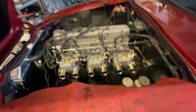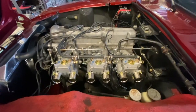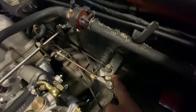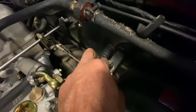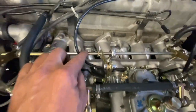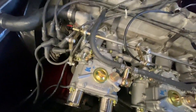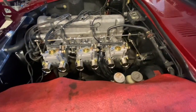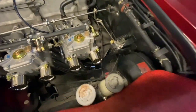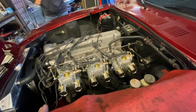We've got the carburetors on and the header on — skipped a bunch of steps for you because it was a real nightmare. Longest hour installation ever. I had to actually cut this bell crank to work with the throttle in the opposite direction so I could put the throttle arms on the other side and make the throttle actually work. Then the rod wasn't long enough, so I lengthened it using another piece of metal so the whole thing would reach the farthest carburetor. Everything's set up — now tightening this up, then going downstairs to the exhaust to get that buttoned up, then we'll put some fuel in it and see if we can fire it off.